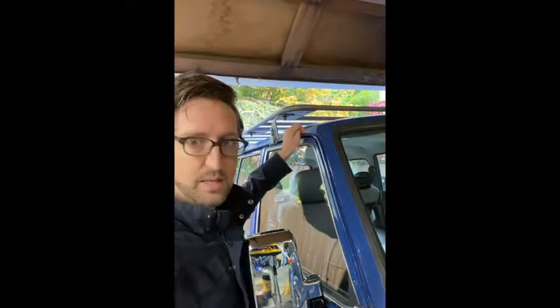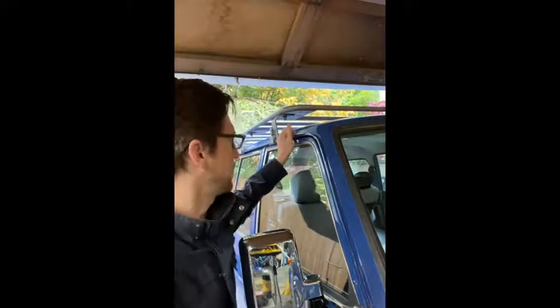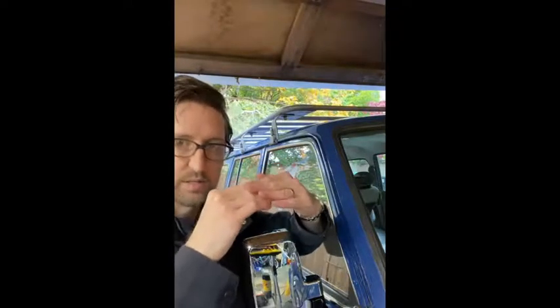Now, there's also that metal seam in this gutter. What Toyota did was put a very thin bead of seam sealer here to cover that metal overlap. It's like spot welds along the inside of the gutter. Over time, that seam sealer can get old and crack. When you have cracks in the seam sealer, water pressure starts going in the crack and attacking that overlapping metal. The water can wick in there, start rust, and open the gap more and more, and it gets worse and worse.